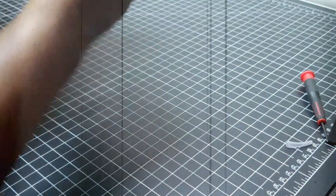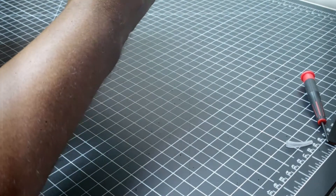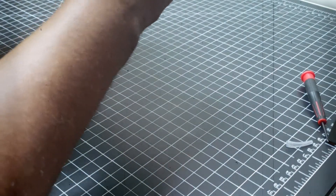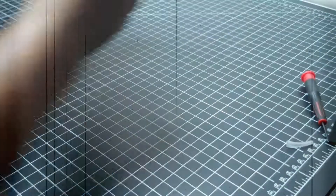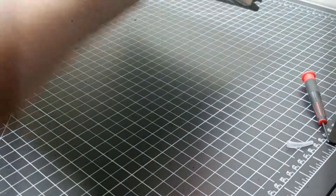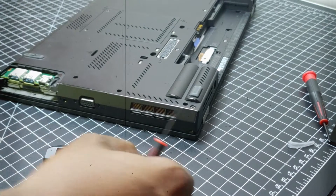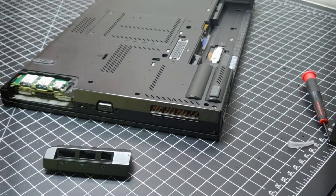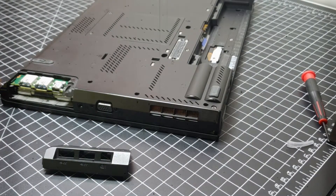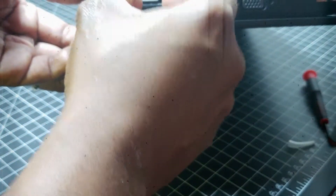So this is what I'll do - turn it upside down - there we go. Easy peasy. I'm paranoid so I'll touch my ground again just to make sure there's no static discharge. Now you're going to look inside here and you'll see there's a little tab, and that is how you get your hard drive out.